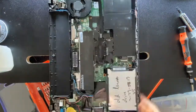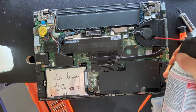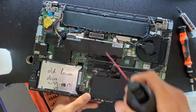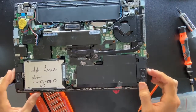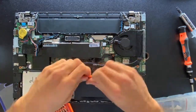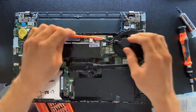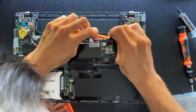Now that we've got good access at the motherboard, we can see the fan and the cooler for the actual CPU. I'm going to use some compressed air to try to get any dust that might be inhibiting the thermal conductivity of our system. After that, we're going to disconnect the fan connector from the motherboard — you need to pull it out parallel to the motherboard, not lifting up on it, using two little plastic tools to help pull it out.